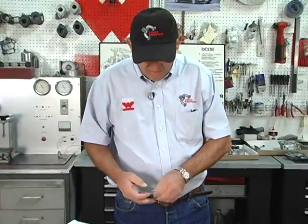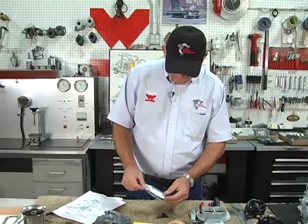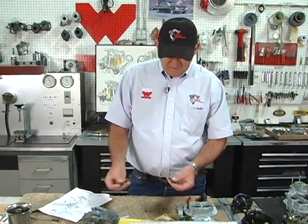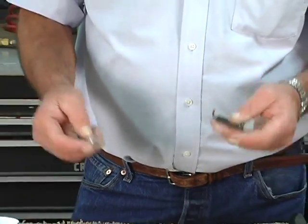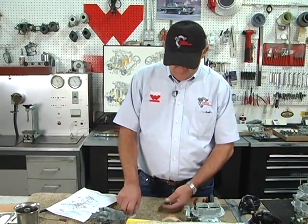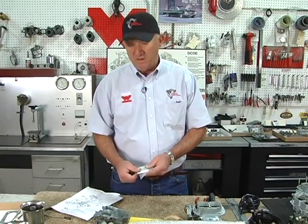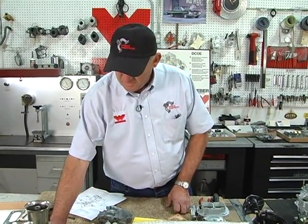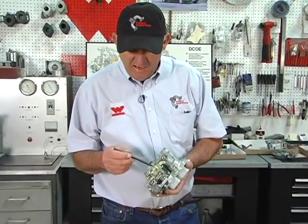When you've got a carburetor that you're pushing the limits of the 32 millimeter primary barrel to have your low speed running drivable, we sell a sync link kit. And it's a linkage kit to synchronize the barrels, to open both barrels together. And it comes with the pump jet to get a squirt down both barrels. And it makes a huge difference in the drivability of larger displacement motors where the 32 millimeter primary barrel is just too small. And we sell tons of them, lots of the Toyota pickup truck, the Jeeps, the BMWs, the Land Rovers. It's real popular and real common. It's not difficult to install. The biggest installation problem that we see is people have a tendency to over-tighten this linkage.